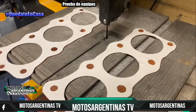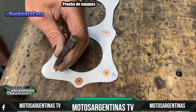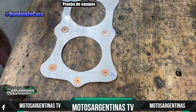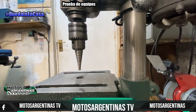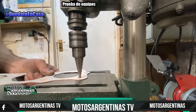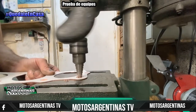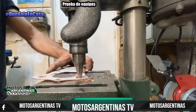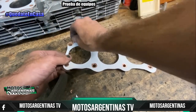With both the gaskets cut out, I go back to the garage to mark out the holes. Using a centre punch, mark the centre of each hole. Now, using my sheet metal drill, I drill the holes where the studs are going to pass through, stopping at the 12mm cutting size. With the drilling complete, I'll remove the template.